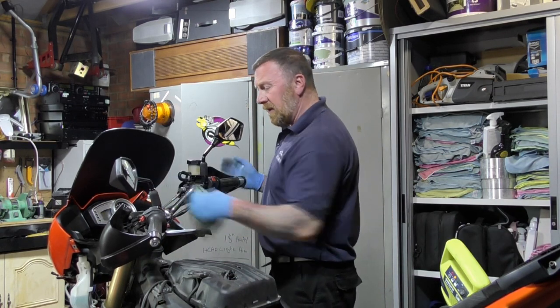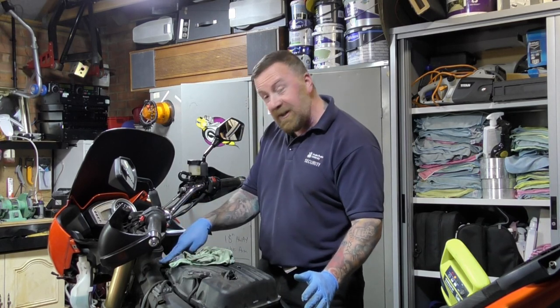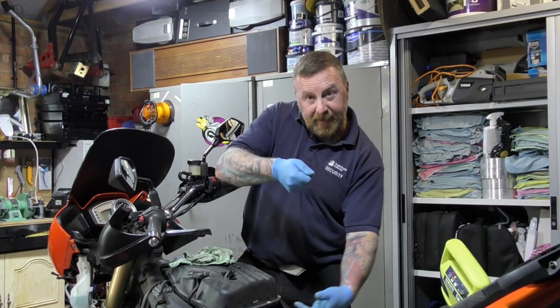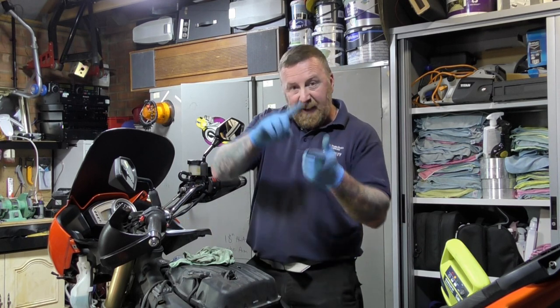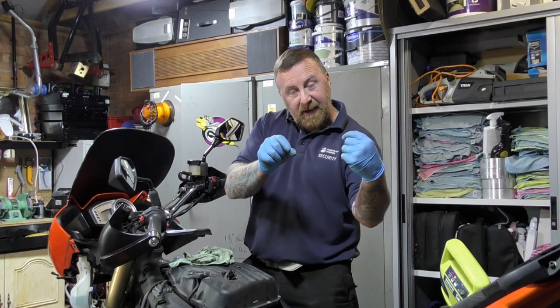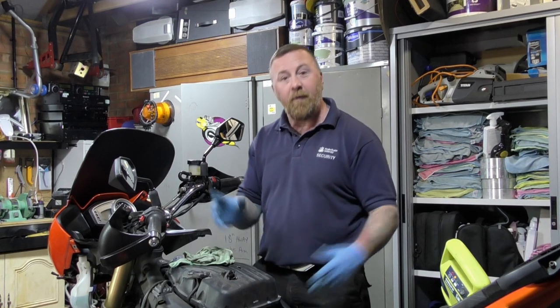Don't need to take the clock ones off, it just slots in. So when you take the two back ones off and you've got this one here, pick it up, or once you've got the panels off, and then get under there. Don't try and take it out, it won't work. So literally, tank still on, lift it up, about that much you'll get up, clip that brown bit down, pinch, that comes off, a little petrol will come out, don't worry, plug, lift up, they pop off, job done.